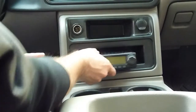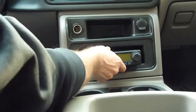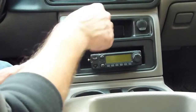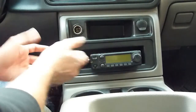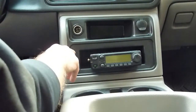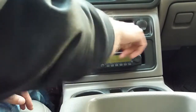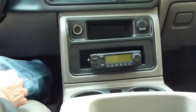As you can see, I've just got it kind of set in this bezel and it kind of fits just as it is. I could take the easy route, just drill a couple of holes in the back of the bezel for wire access, and maybe brace this in here, and it would be fully usable. But I'm a little bit concerned about airflow and heat management on the radio, so what I think I'm going to do is modify this bezel internally a bit so that the radio can breathe a little bit better.